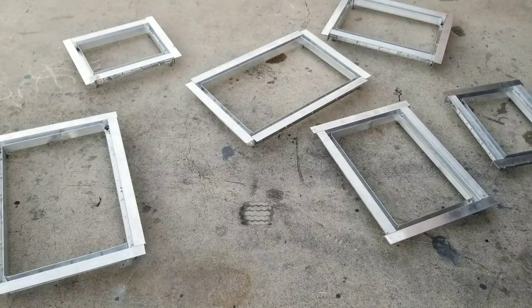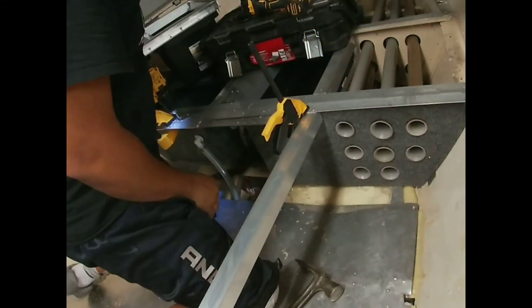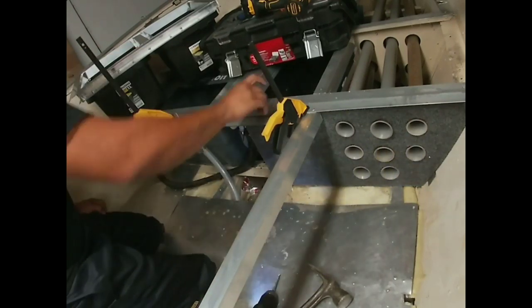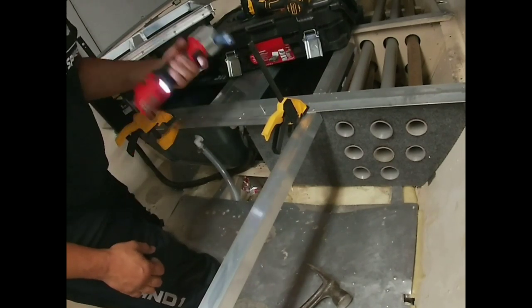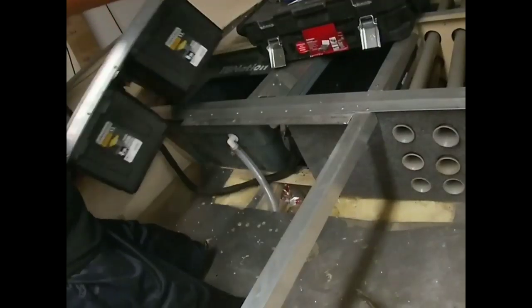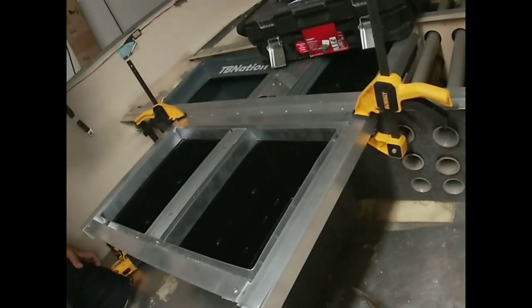Gen 3.2 is the wood aluminum hybrid version of Gen 5, and you use far less angled aluminum in that version. Gen 5, just in case you're wondering, is a series of independent slats — there's no true core anymore. What that does is give us freedom to frame anything out any way we want without having to rely on a core part where you can only run the hatches a certain way. You can stick them anywhere you want in puzzle pieces. As long as you have spots like this 1/8th inch piece of flat bar to join them, you can do it. This is a 3 inch by 1/8th aluminum flat bar sheet we're going to stick between each part of the angle to join the Gen 5 on there. Then it'll sit on the rail, we'll install the other side of the rail, and then we'll show you how we do the foam walls.